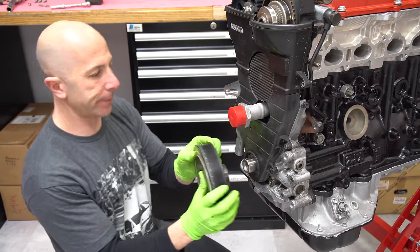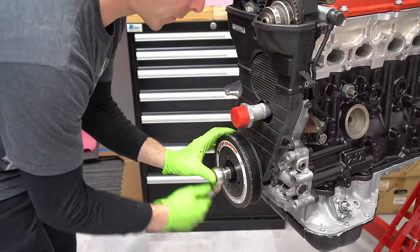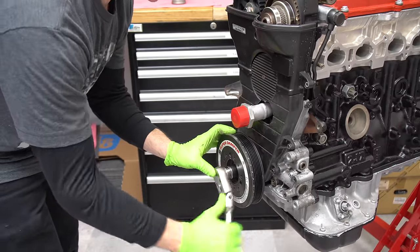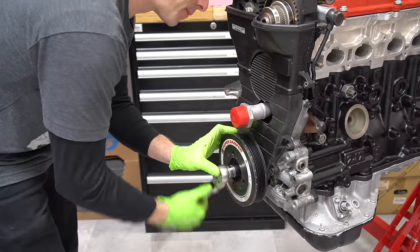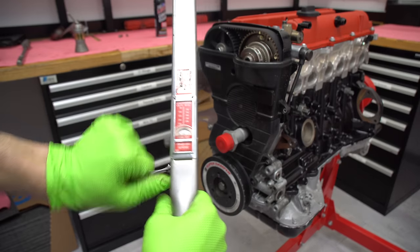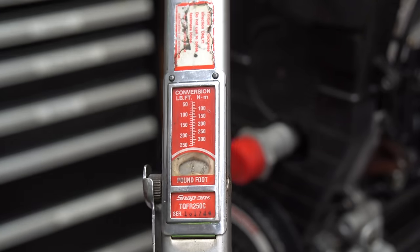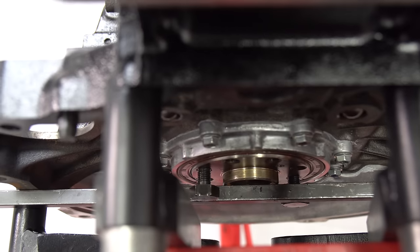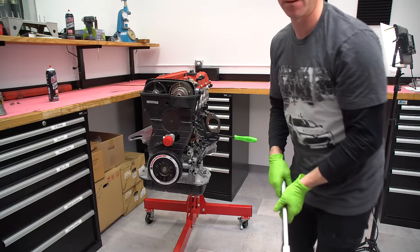You can use the pulley bolt to push on your crank pulley, but only if it's really easy to go on — this one was super easy and didn't have much resistance at all. But if you do have some resistance, you'll want to use a specific installation tool. If you put too much force on this pulley bolt, you can mess up the threads inside the crank, and you're gonna have a real bad day. The torque on this pulley bolt is actually 239 foot-pounds — it's really crazy high and pretty much maxes out the torque wrench. In order to get that much torque, I've got to lock the crank from turning. So I've put a couple of flywheel bolts into the back of the crankshaft and wedged a pry bar in there so the crankshaft can't turn.